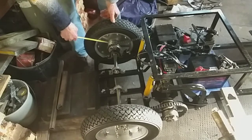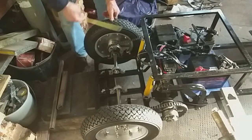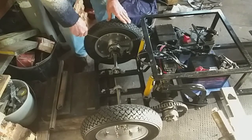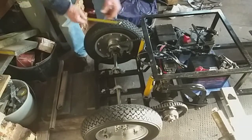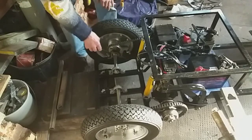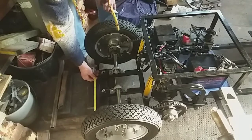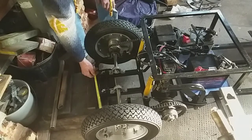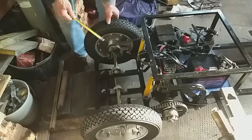I've got one more of those spacers on the back here - I had four on the front but I've ended up putting another on this side because the chain was rubbing on the tyre, so I've had to clear that. After welding on the two 11 and a half inch bits on there, I've put another bit across there - same box section, 30mm - then these two bits in the middle, and that has enabled both axles to go like that.